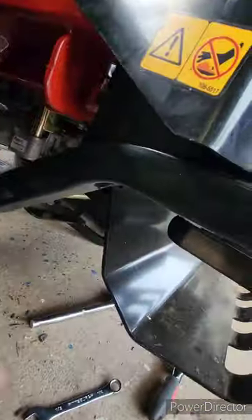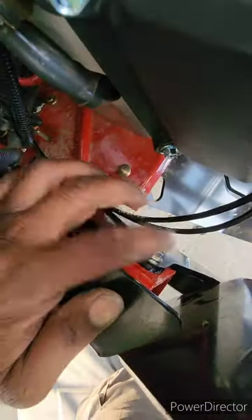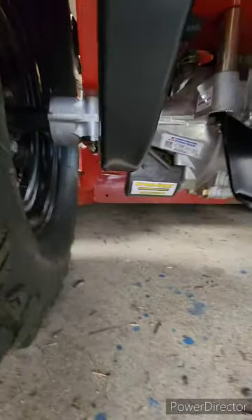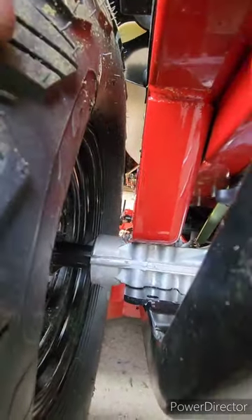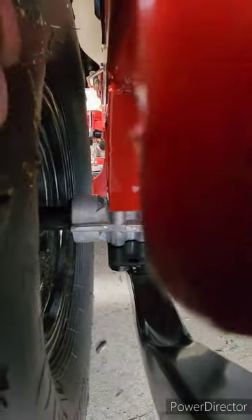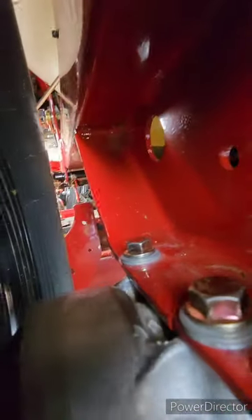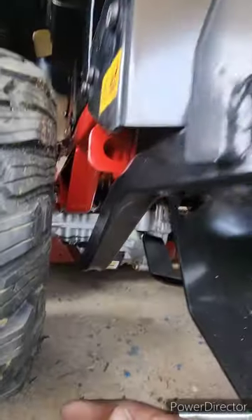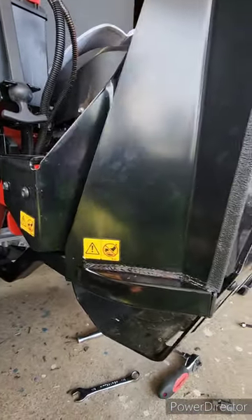You're reusing the bolt that goes in these brackets. It goes around — not underneath — it goes around and under like that. Those bolts that hold the drivetrain are also 13 millimeters or half inch. You can see the bolts there — tighten them to whatever torque they call for.